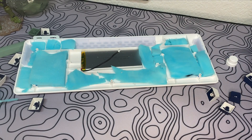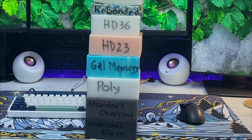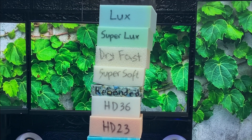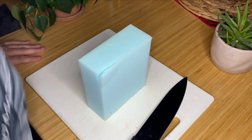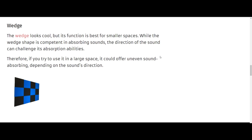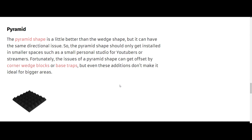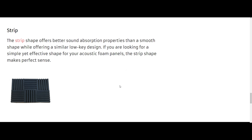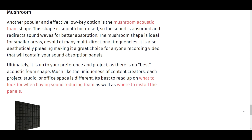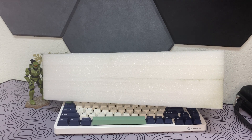I'll be putting the board back together with memory gel, including the tape mod. I think I'll keep the PCB foam out for now. The fact that the majority of these foams sounded the same tells us something interesting — there are a few types that might make the sound slightly different, but when it comes to sound absorption, material and shape is more important. I found that most soundproofing companies offer their foam in different shapes and densities. Quote: with smooth panels of foam, sound can actually be reflected rather than absorbed. So the bigger impact will be size and thickness, even though some materials can play a role. Go ahead and slap some packing foam in there — just cut it thin and maybe make sure it's not flat.